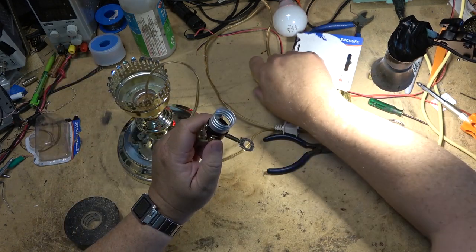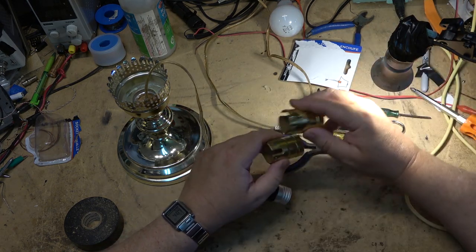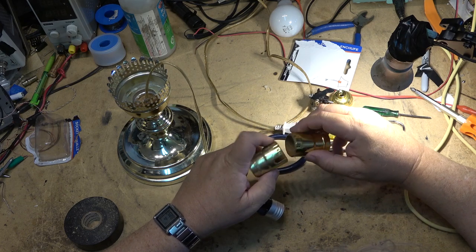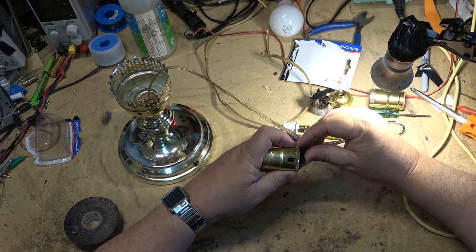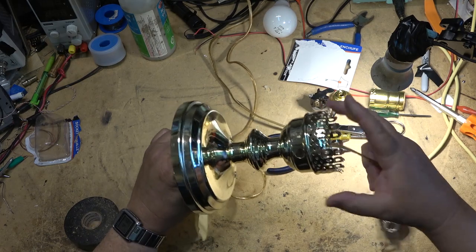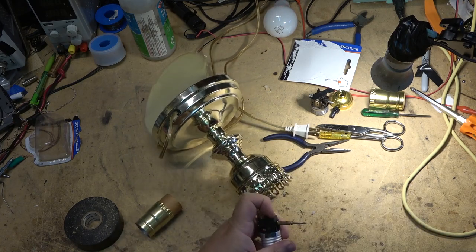Now let's see whether I can snap this together. Both clip in exactly the same - six one way and half a dozen the other, they're both the same - so I'll use the original one. Once we get this done, we'll take apart that other lamp socket to see what went wrong with the switch. I'm sure the contacts are just pitted. I have to undo this right now because I have to screw this on after the fact - I have to get it through the base - so let's take this off and put it back on.